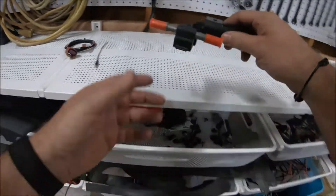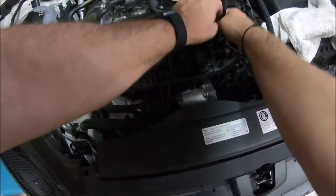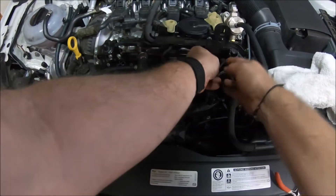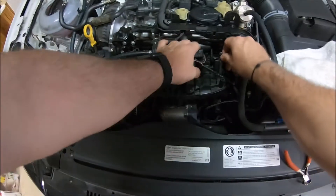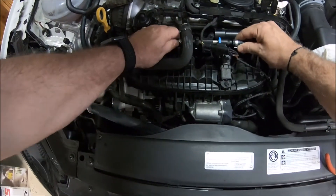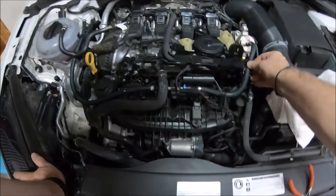Go ahead and grab our sensor and analyzer, take the little caps off. In this car, we've already got a JB4 installed. The sensor just clicks in place. We've already run our wiring harness — it comes through and runs down around here over to the battery area, underneath the charge pipe. We'll go ahead and plug that in, feed it over there, and then for the line to the HPFP, plug that in. Pop the fuel line into the little clamps here. So that's it — our fuel line is installed and everything is good to go.